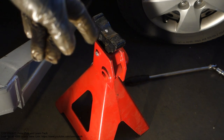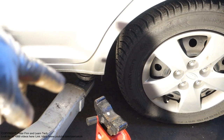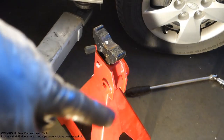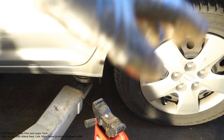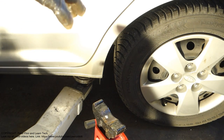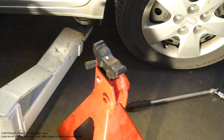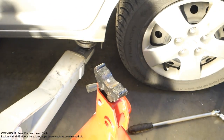Steel support jack stands are best, and we need to insert those just below the car body, like this gray bar here. This tool is a safety thing for us, because sometimes the car jack breaks and the system collapses. Then when we are working in there, our head, body or foot can end up between the car body and the ground, and it is a horrible situation. And remember, I have never tested that, because it kills.